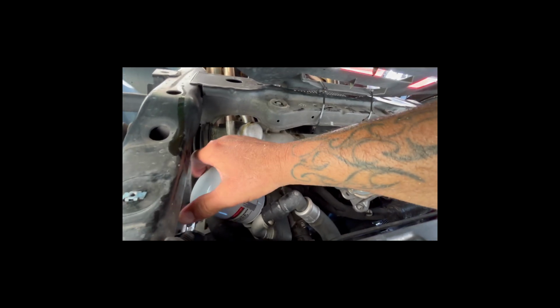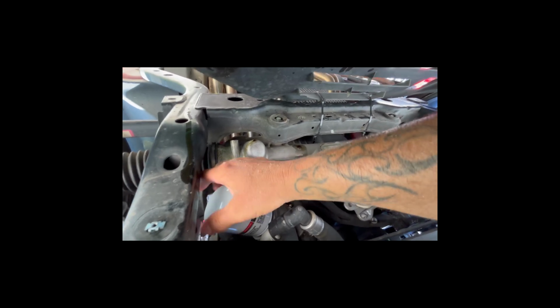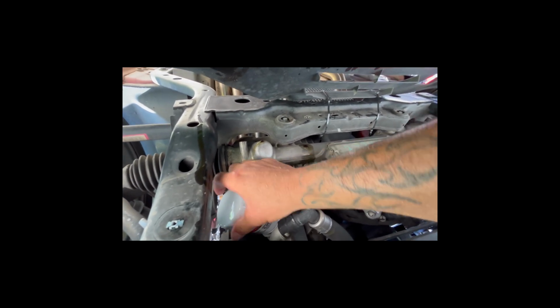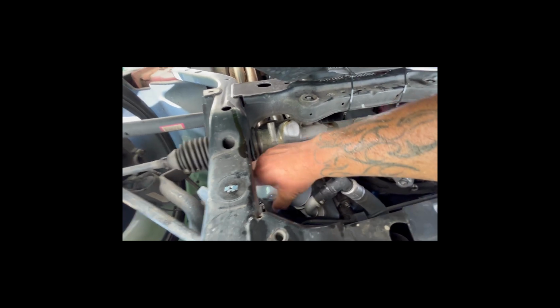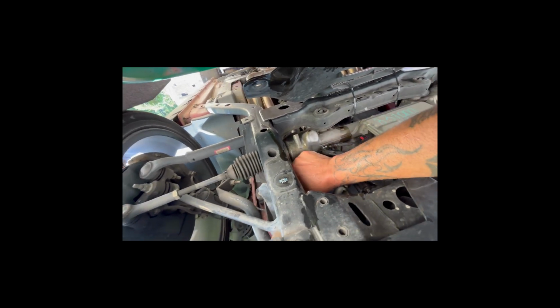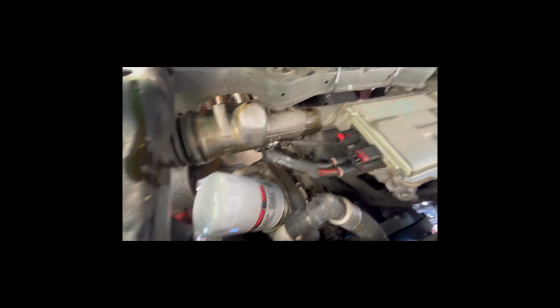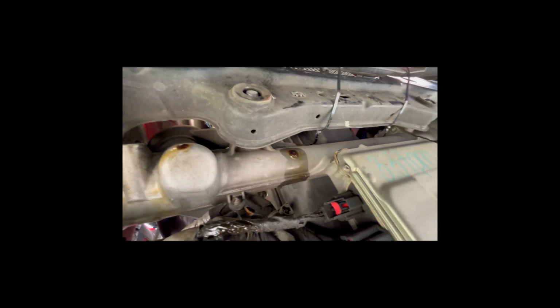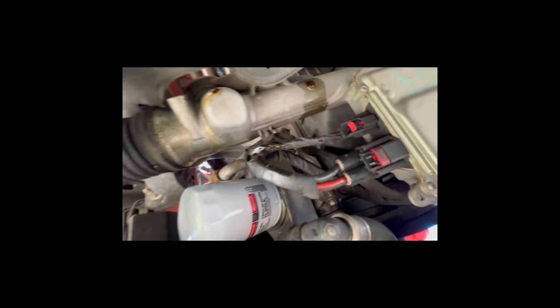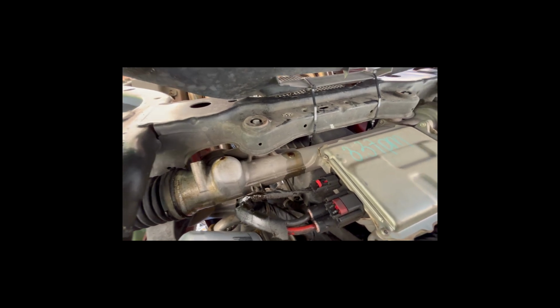And when you tighten your oil filter back down, don't use your oil filter wrench. Just use your hands. It will seal fine if you just use your hands. Turn that thing on there. Hand tight. There we go. All right, now I'm just going to clean this oil that we have dripping here on these wires and things. I'm going to clean that up. I'm going to put this plastic piece back on after I clean it up, and then we'll be ready to add the new oil.